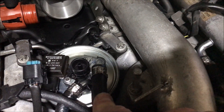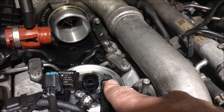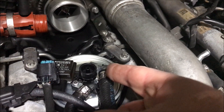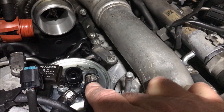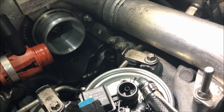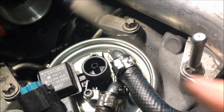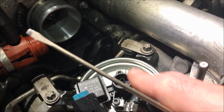There are two fuel lines here with clamps on them. A lot of people will say they are single use clamps — they're not. You can put a little flat slotted screwdriver in here and they'll pop out, and then you can crimp them back together; just close them up with a set of channel locks or pliers. So I'll pop both of them. Just drop the screwdriver in there — popped open, clamp's loose. We'll do that to both of these and just slide these hoses off.